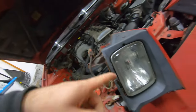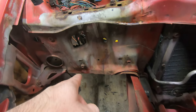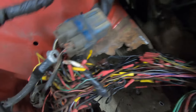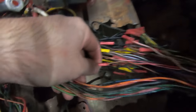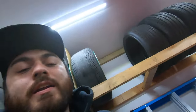Got the headlight off and behind it there's some rusty nastiness. We're going to clean all that up. I did get to de-looming the main harness and while I was tracing it, looks like they just extended it - must have just cut it for some reason. This is a typical case of 'I know somebody that can do it cheaper' because every one of these has copper exposed, and doing a brief check I've already found a few wires that are close but not the same.